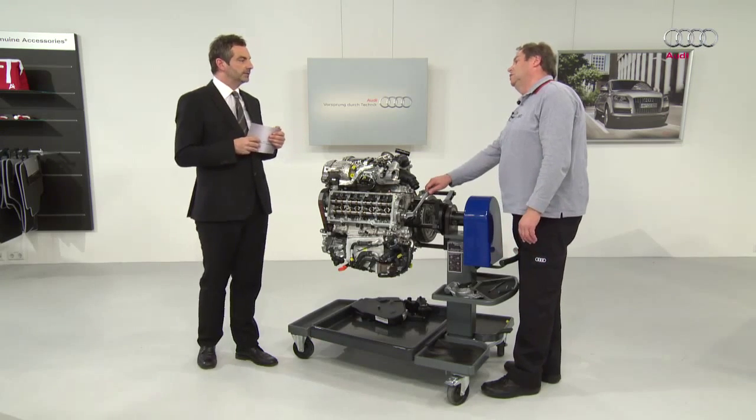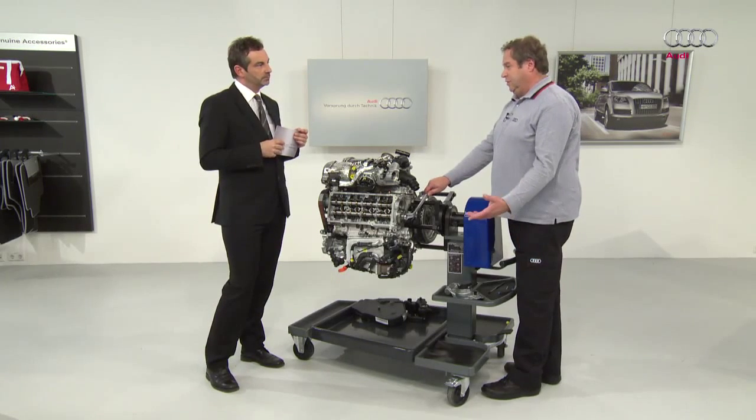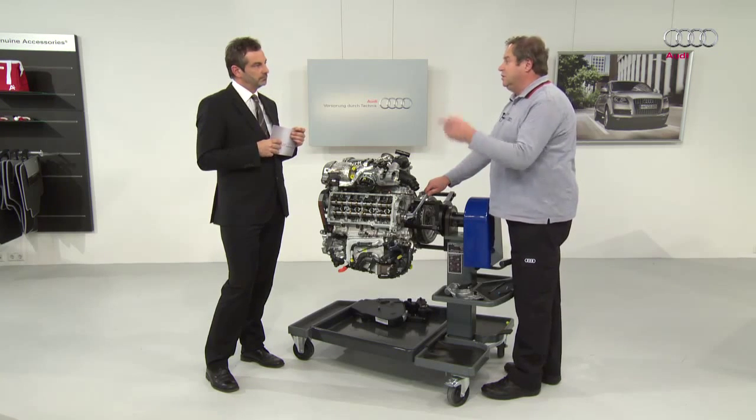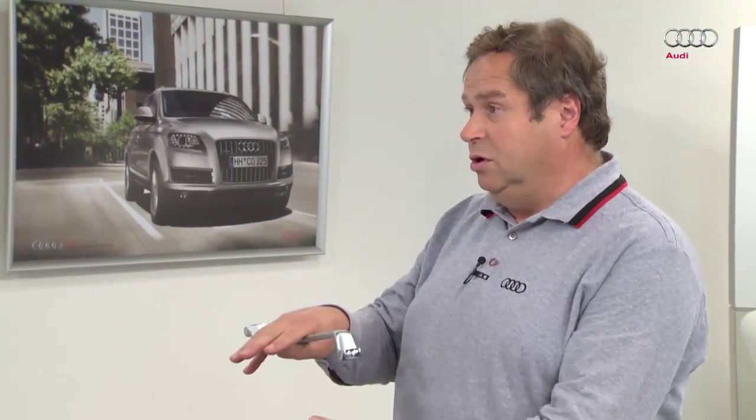But you don't want this effect if you want more power. You don't want the valve to stay open for longer. No, if you want more power, you need to play with the outlet valve in the same way. This produces a better fill level and an improved flushing process. However, by keeping the valve open, aspirated gas returns to the outside. This occurs after reaching bottom dead center when the compression actually starts. So the compression changes. This in turn reduces the pressure and the temperature in the combustion chamber. In this way, the amount of nitrogen oxide is reduced.